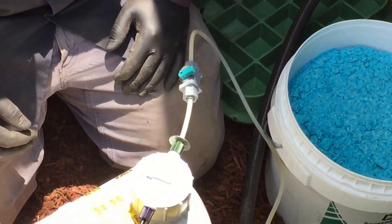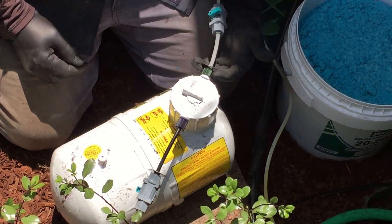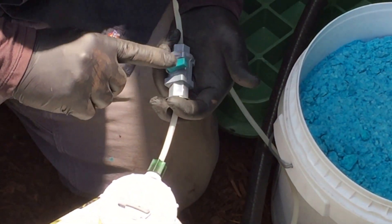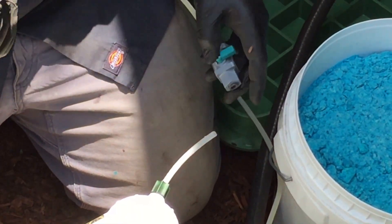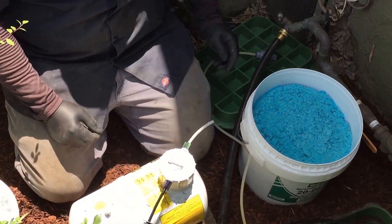To go ahead and get these off, they are made of compression fittings. There is a washer — you will simply put that in your two fingers there and apply pressure. Very important: keep both these in the off position. If not, you will get soaking wet. Apply some pressure there and it comes right off. These are the same type of compression fittings that are on most refrigerators for the ice maker and the filtered water.